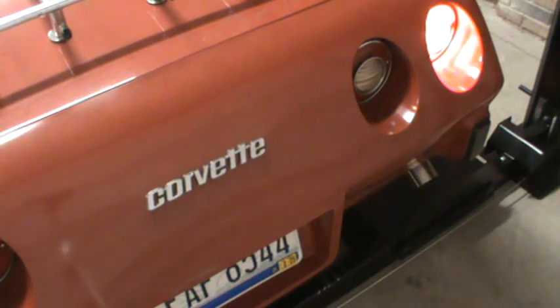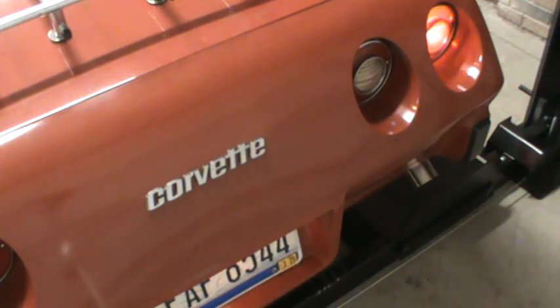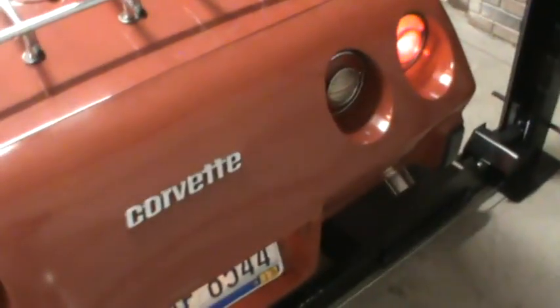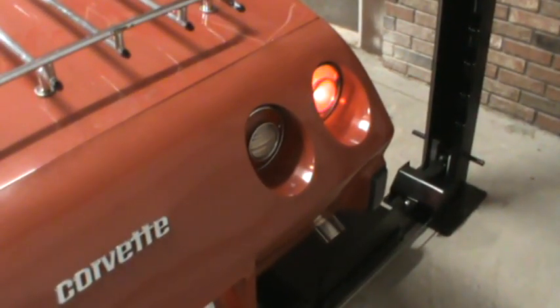Well, actually there's two things I have to show you. I'm going to show you first, turn signal off, parking light on. It turns out the upper signal is the parking light, and I do have that now, both sides. You notice they're maybe a little dimmer than the turn signal lights. These are your running lights, so I'm sure that's normal. But when I replaced that socket and got the ground to be good, what happened was both filaments started working.